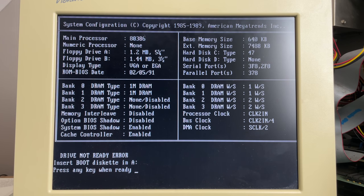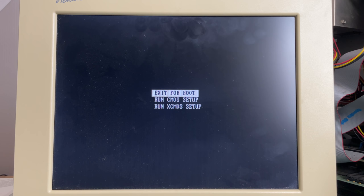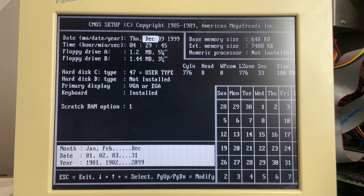While we're waiting for a miracle in the hard drive department, we can take a look at the system configuration provided by the AMI BIOS. You actually get to see a lot of information here - normally you only see the top, but in this case we also get to see the DRAM types, the timings, the wait states, and other CMOS-related information. This is a really old CMOS setup comprised of two items: the basic CMOS setup and the extended CMOS setup. The basic CMOS setup allows you to configure floppy drives and hard drive, and it has kept all of its settings: the 5.25-inch floppy drive marked as A, the 3.5-inch as B, and a user-type hard drive of 100 megabytes.